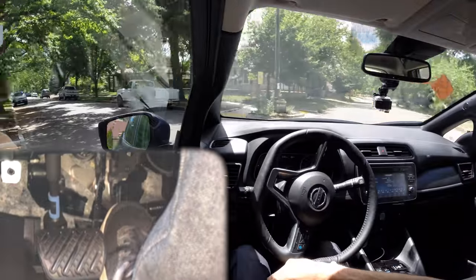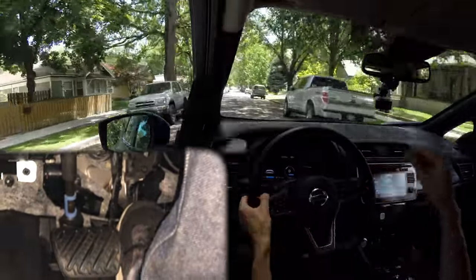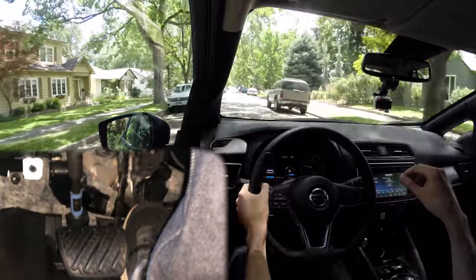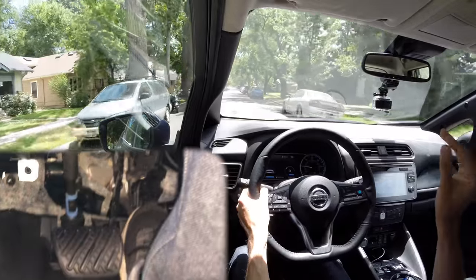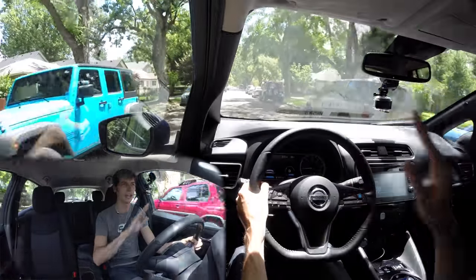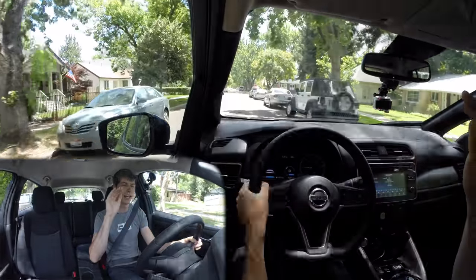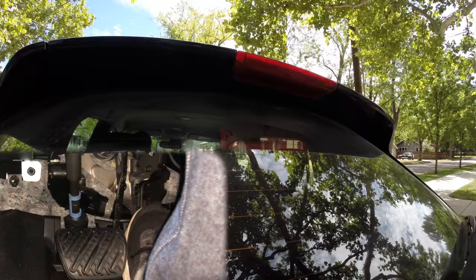There is a slight difference in how it feels when you have it in e-pedal mode. Initially there's a bit of braking where you push in and it doesn't do much — you'd feel like you have your 0.2g and then have to get into the brake pedal a little more to add to that. So touching the brake the first time feels a little weird, but it's certainly something you can get used to.